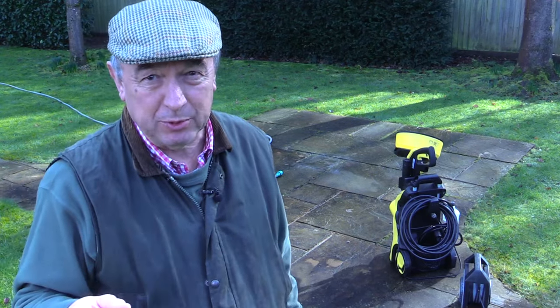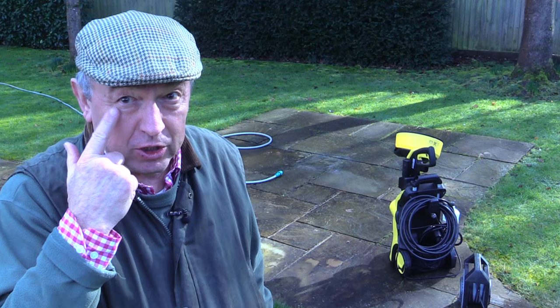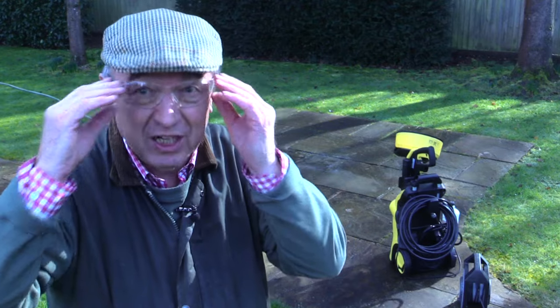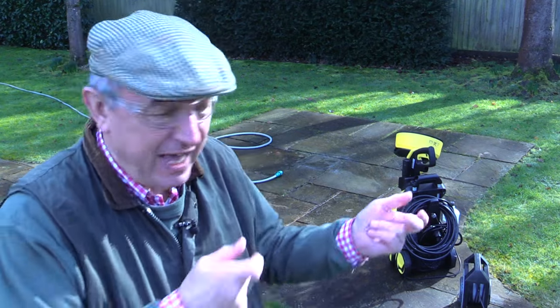The first thing I want to do is talk to you about safety precautions. When you use a pressure washer, it's quite possible that the force of the water can cause small stones or chips of wood to fly in the air, and you've really got to look out for your eyes. Always wear some form of eye protection — safety glasses, good quality plastic glasses, or sunglasses. The other precaution: never aim the nozzle at people, pets, or animals of any description, because the force of the water is really, really powerful — you can blind someone or cause skin injuries. But don't get worried; this isn't a dangerous operation, these are just the precautions.